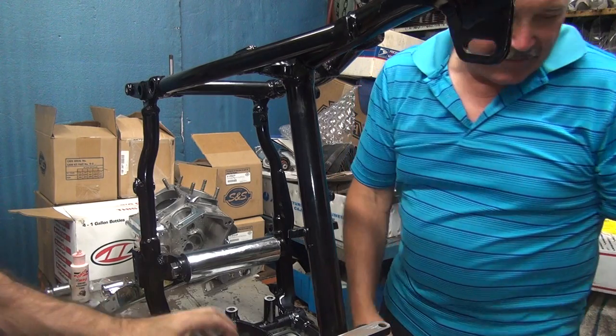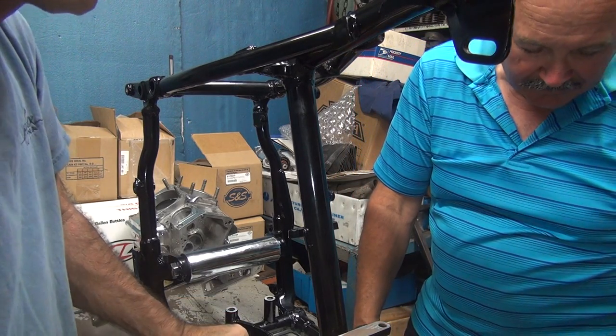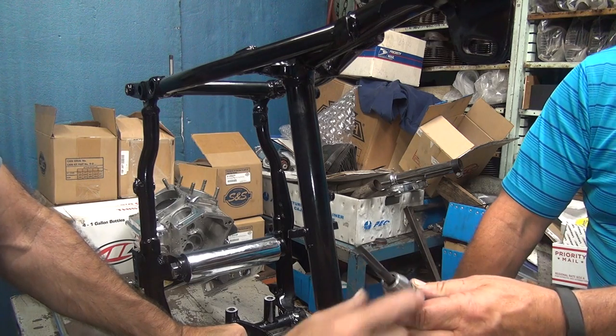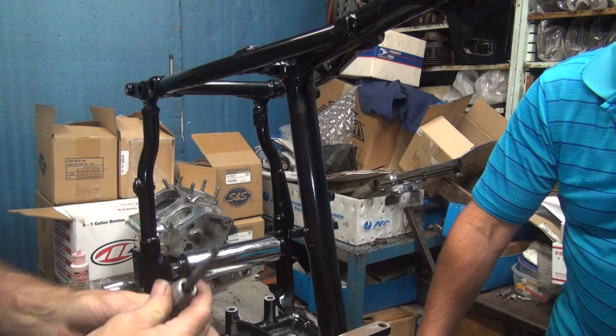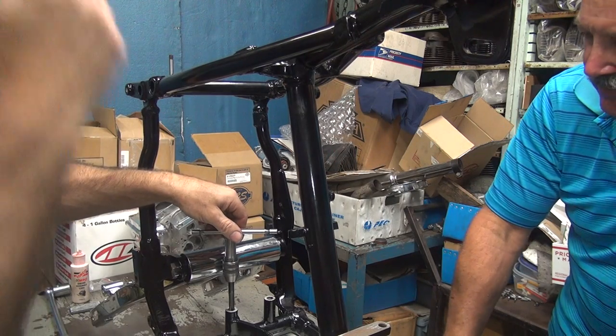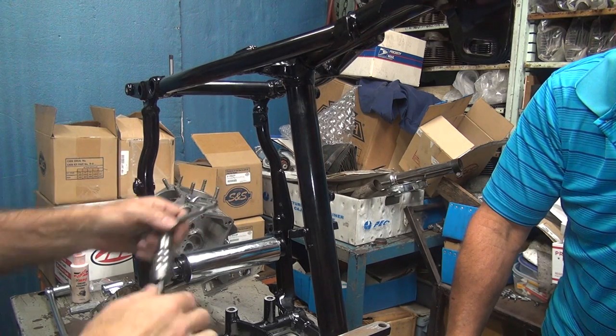That's that fine thread tap, too. Where's the fine thread one? You should have been using a black tap, did you? Yeah, I used a black tap. It's right there. There you go. Look at that. Fred used the correct tap. We need a bottoming tap, though, of that same size for these. Fred, this doesn't fit. Really? Did I just say that a few minutes ago?